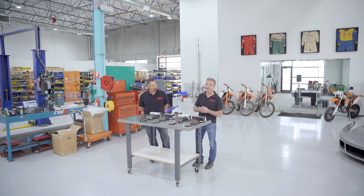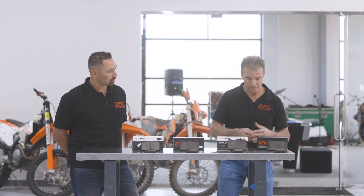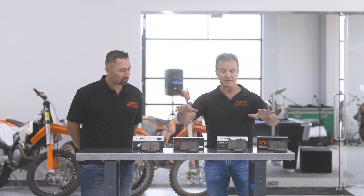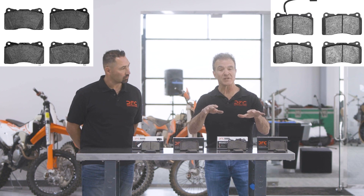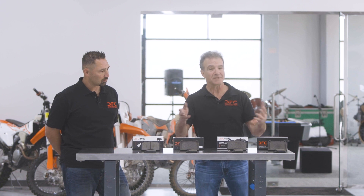You cannot do that if you really want to have an effective brake system, or certainly if you want to restore it to the way it worked originally. We have four different pad formulas in the same exact shape, and three out of these four are actually very specialized low metallic brake pads. Just getting to have an effective low metallic brake pad is one thing, but when you understand that most of our competitors would use a semi-metallic as a replacement, now we're talking a whole new ballgame.